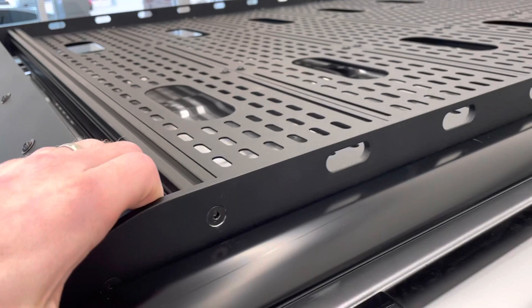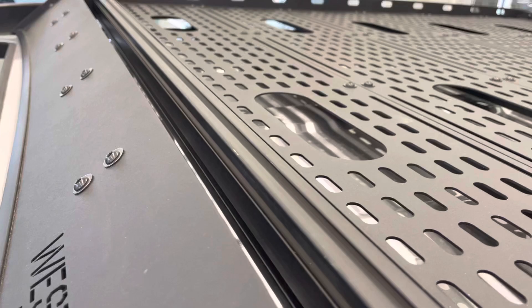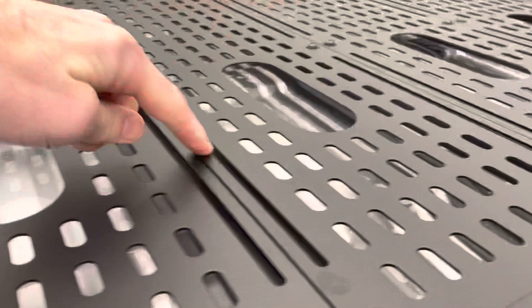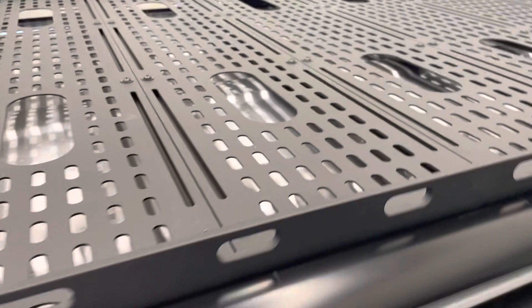In terms of the construction, it's all aluminum. The cross members are 80-20 bars — we have one behind the wind fairing, another 1x2 80-20 right here in the front mounted vertically on the frame. In the rear, the other 1x2 80-20 frame is also vertical. And then for the cross member bars for support, there are 5 total cross members that are the same 1x2 80-20 bars, but mounted horizontally.